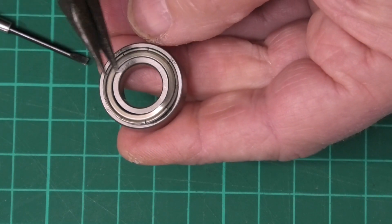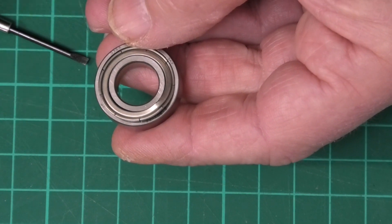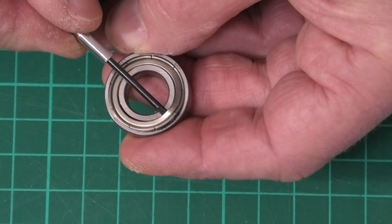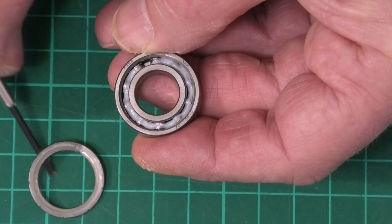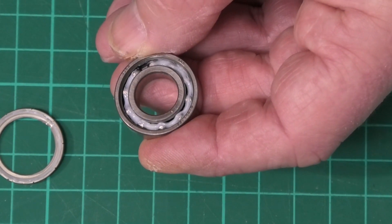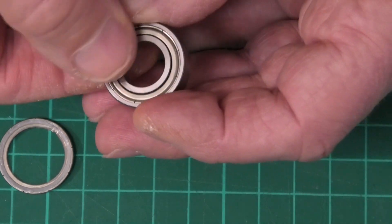The reason I've got the nose pliers is because if it was really tight I might just grip the edge. But as I said you need to be really careful not to push the screwdriver in under that shield cover, because if you do you'll damage the ball retainer inside. And you can see there that's packed with grease nicely.